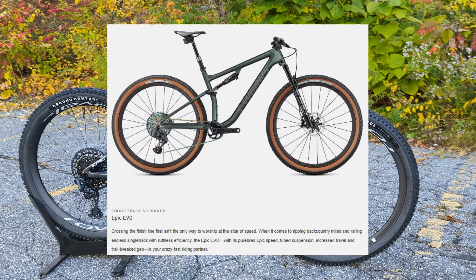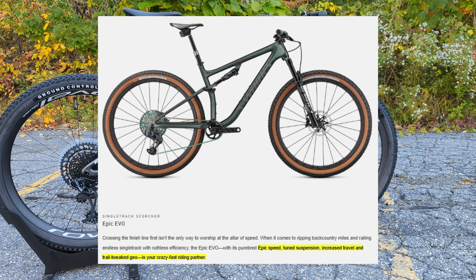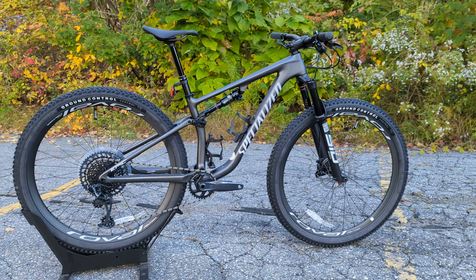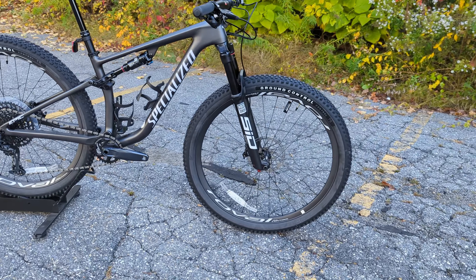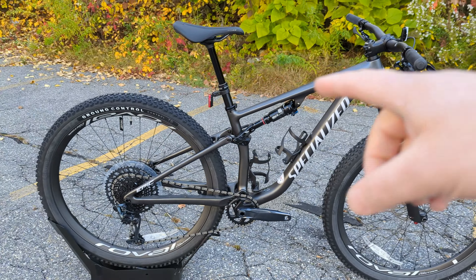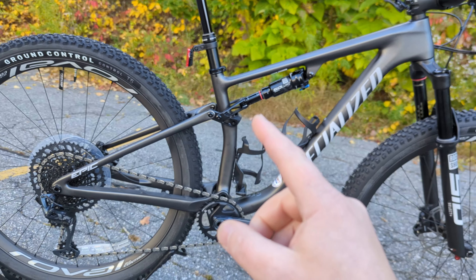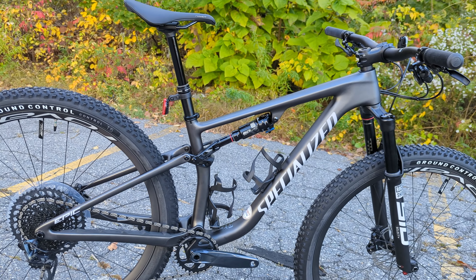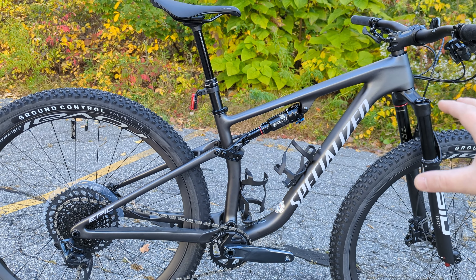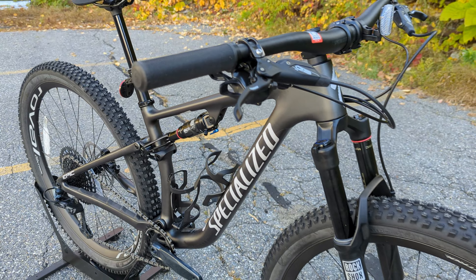The bike in front of us here is for that racer that maybe wants something a little more lively and playful, or potentially a rider looking for the lightest weight way to have a ton of fun. If the standard bike is 100mm of front and rear travel, this bike is now rocking 120mm of front suspension through this RockShox SID fork, and out back revised linkage and a slightly different shock give 110mm of suspension travel. Unlike the XC race version, the Evo omits the brain both front and rear so the bike feels active like a traditional trail bike — taking some of that XC performance and making it more fun and lively.